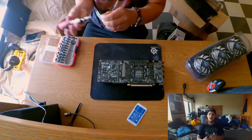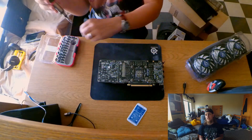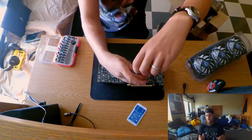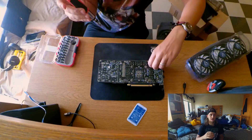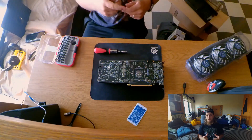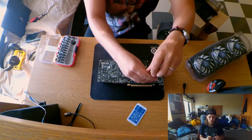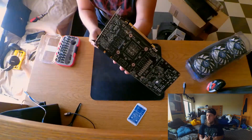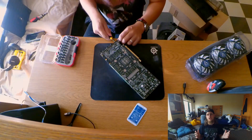You also start to look at the price. A basic 120mm AIO, you're looking at about $50–$80. Then you've got to get the adapter bracket, or do the zip-tie mod. So you're at $50 for the AIO, and then you need a bunch of tiny copper or aluminum heatsinks for your VRMs and maybe your RAM — another $15–$30. Plus thermal adhesive or thermal pads, add another $20. With a $10 cushion, you're up to about $110 to cool this graphics card.